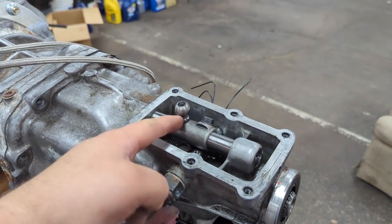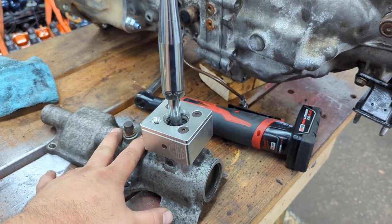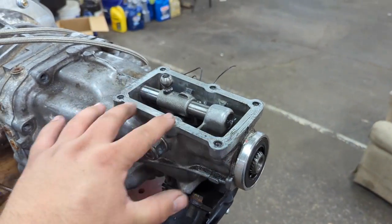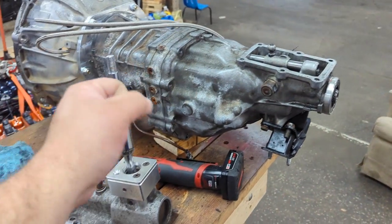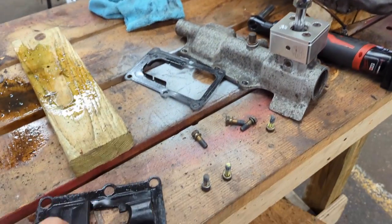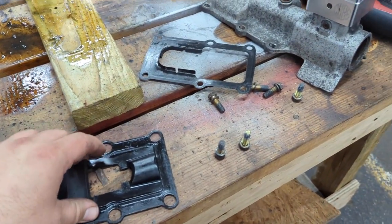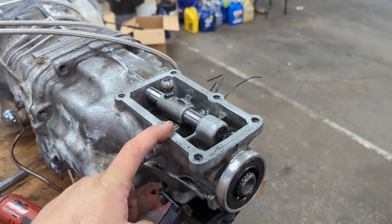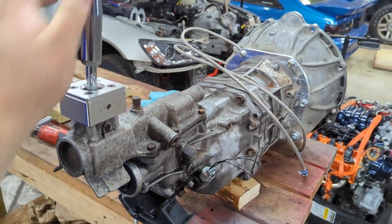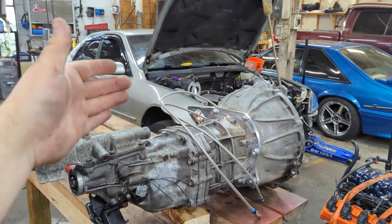After swapping the rail, the piece is now about half an inch further back and things are looking good, but I need to shim it. When I bolt it all the way down with the metal gasket from the IS300, it binds up — but loosening the bolts lets it actuate freely. I'm going to stack the thicker rubber gasket from the W58 on top of the metal shim to free up the binding. After putting the thicker rubber gasket and metal shim on, the shifter works. We've got a fully functional W58 converted to work in an IS300 with a 1UZ.